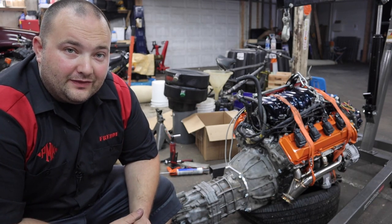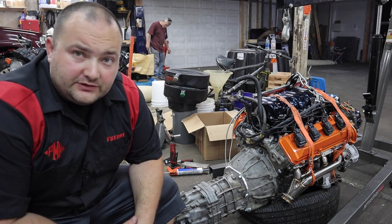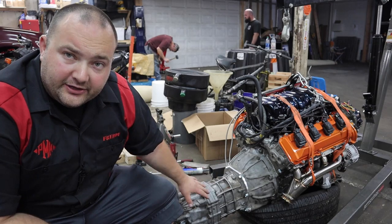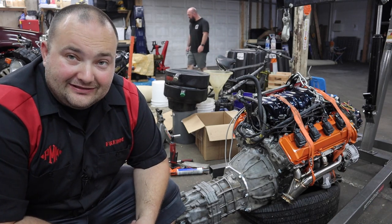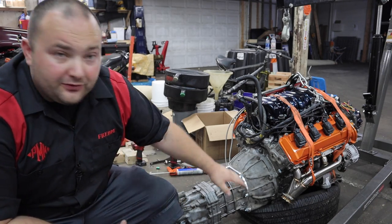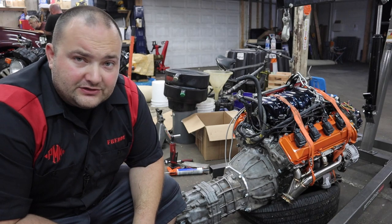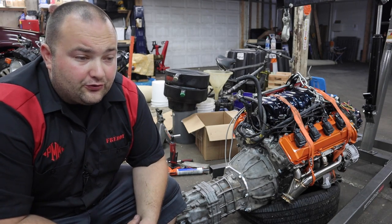That concludes this part of the series. We got the transmission all together, bell housing converted, and mated to the 1UZ. Ran into a couple of issues — I did not know you had to swap over that rod inside the transmission, which took a lot of troubleshooting. For the transmission mount, I'm running an IS300 mount on the bottom of the W58, but only two of the four mount bolts attach since the transmission is missing the bosses for the other two. Other than that, the bell housing conversion kit worked flawlessly. I'll have a link to the kit in the description. The clutch is the XAT Racing Stage 2 — pretty mild, since this is basically a stock motor with headers.